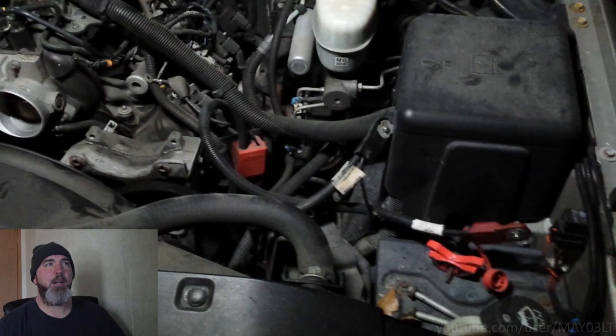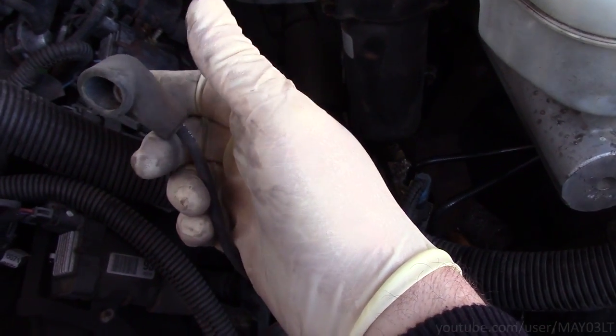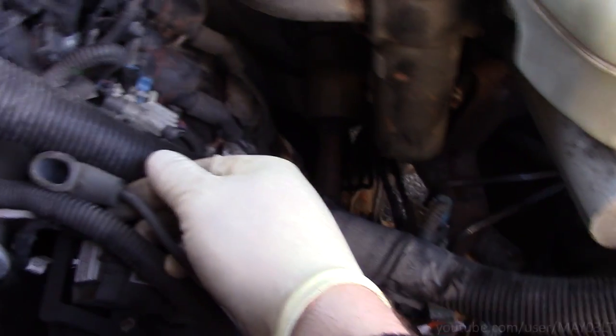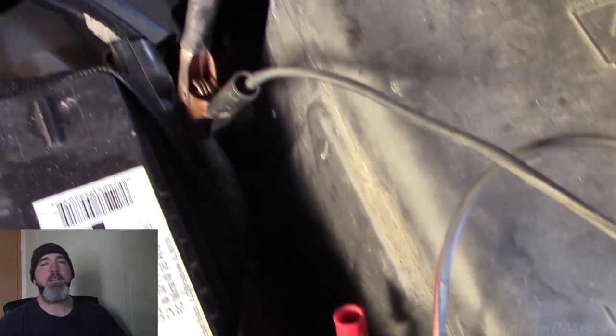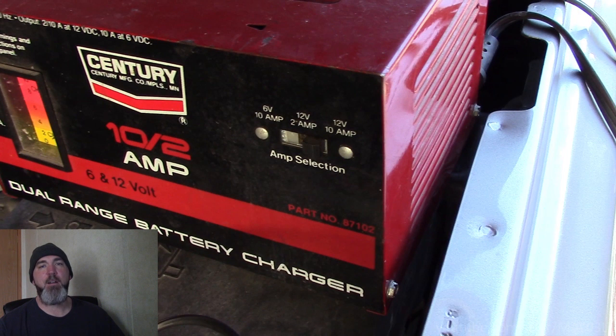I'm also going to charge the battery in this Silverado but I'm not going to take it out. What I'm doing is taking the B plus lead and tucking it back in the boot, then securing the boot between the wire looms so it doesn't move. Then I'm hooking the negative cable back up and connecting a low 10 amp trickle charger. The reason for doing this is the truck was also driven without the alternator working. A really weak battery can put like a 30 amp load on the alternator, and this truck runs off about 60 amps with all accessories — so adding another 30 amps could burn out the new alternator really easily.